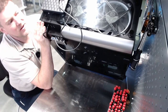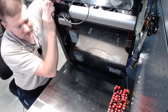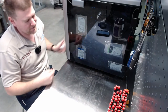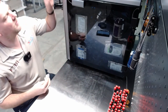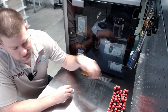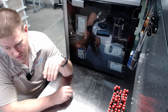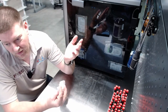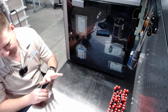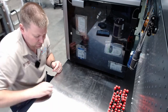So that's my exhaust, and you can see I lifted the glass plate. I put spacers in there to lift it up, and I put different fasteners in there so that it gives me a vent. But at the same time, it prevents anything from really getting into the fan blades. The cool thing about these Thermaltake fans is that if you start to slow them down, they'll throw an error code. If something gets in by the blades, it'll throw an error code and then slow the fan down or shut it down completely, which is a safety feature because I got little kids and they like sticking their fingers in, and it might just scare them. There's nothing dangerous about how fast these fans are spinning, but nonetheless, it's good to have that safety feature.